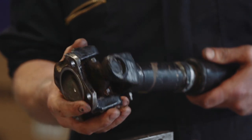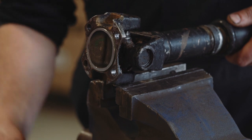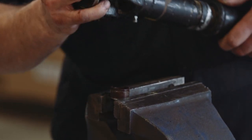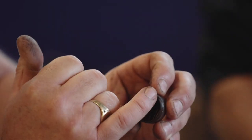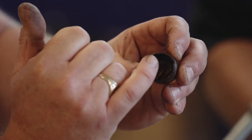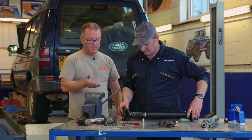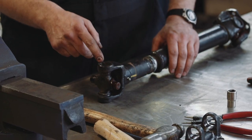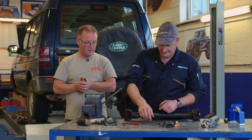What you might have to do on some occasions is pinch it in the vice to remove the cap the rest of the way. That's out! So here's some evidence as to why it might have failed — part of the bearing cap has gone and there are the needle bearings inside. It's not very pretty. So we now repeat for the other side of that yoke — we repeat the same process: tapping the caps, removing the circlips, and then tapping out to remove the UJ.